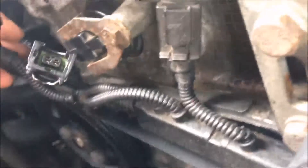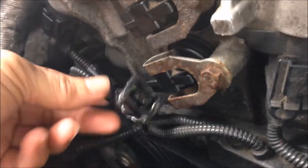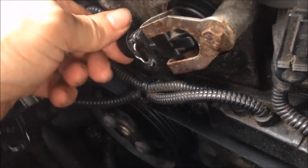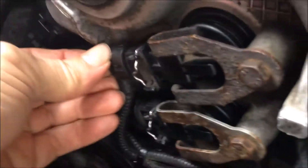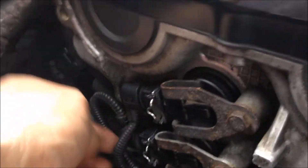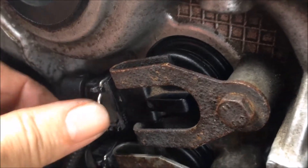So we put back the plug for the block. The shape of the plug you can see — you won't go wrong. This one is for the lower one, this is for the higher one. So we put the lower one in first, just push the line together. Check the plug is locked in place — you won't be able to pull it out without pressing the spring. The spring locks the plug. Make sure everything is okay.